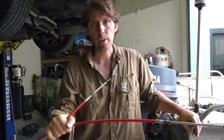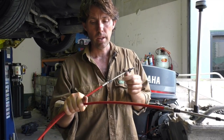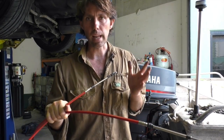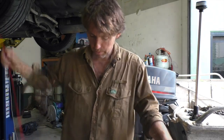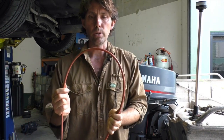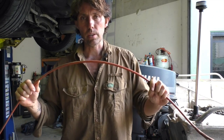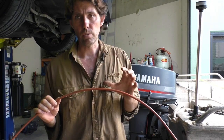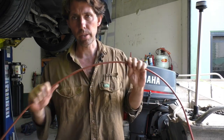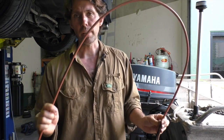The length of these cables doesn't affect how they operate. What affects the amount of travel you get is simply how much of the cable is moving in and out. This cable can be 100 metres long or 1 metre long — if you're still getting that much travel it'll have the same effect. All the length really affects is how neatly it fits into the boat. If it's too long you'll have a lot of cable to loop up somewhere. All cables in their spec will have a minimum radius turn — be sure to avoid a turn tighter than that. Also make sure you have enough slack and a bit of a loop as the cable comes onto the outboard, so as the outboard turns in both directions there's plenty of free play.